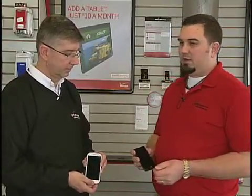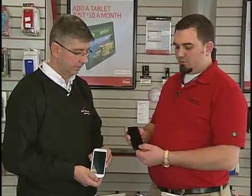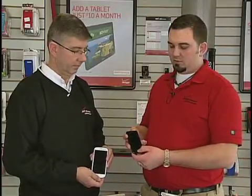On the Apple phone, there's no battery that you can pull out. So to do that soft reset, if your iPhone may not turn on or it might be stuck on an app, what you'll do is hold down your home circle button and the power button at the same time. Hold that for about 10 seconds or until you see the Apple symbol pop back up on your screen. That just does a soft reset and that'll fix a lot of issues on the iPhone.